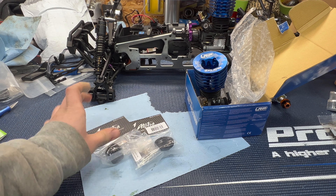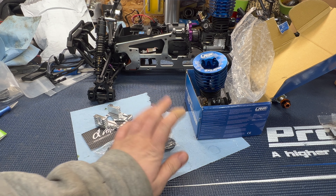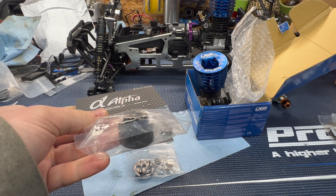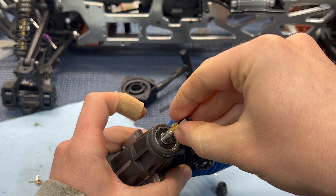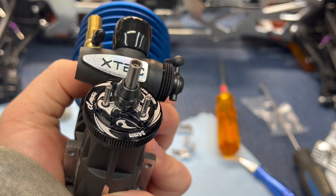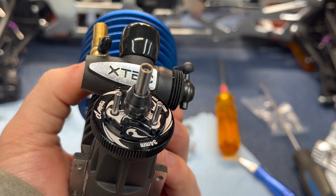Beautiful work, very good job, very happy. Now I'm going to show you why you might want to disassemble and clean your engines brand new — especially your cheaper Taiwanese engines like your LRPs. All I'm going to do is tip it upside down, spray it out with brake clean, and just watch all the crap that comes out on this fresh rag. You can see from that little spray — check out all the metal shavings, some metal shavings, some casting sand.